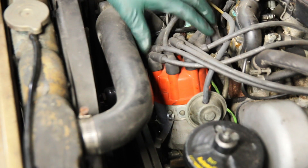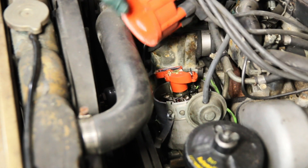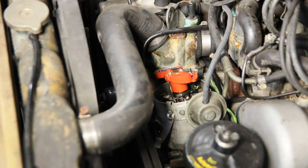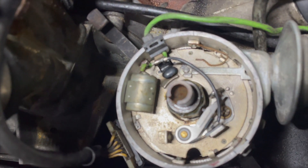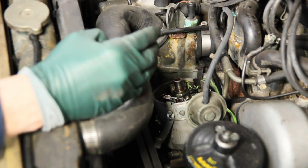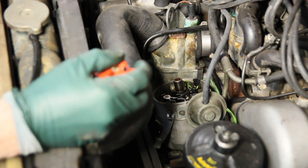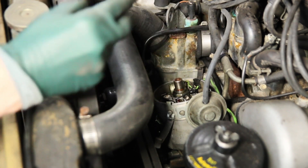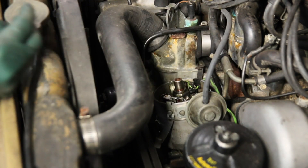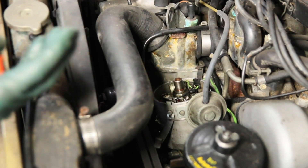The distributor on these early V8 engines is located right on the front of the engine, so access is easy — it's easy to work on them. You pull off the distributor cap and here's your rotor. You remove the rotor and right underneath it are the points; off the side is the condenser. The nice thing about this conversion that we sell is you don't have to mess up your distributor. You don't have to change the distributor cap or the rotor. And if you remove the points and condenser, you can install the components for the electronic ignition. If sometime in the future you want to return your car to original, you can reinstall the points and condenser and go back to that old system.